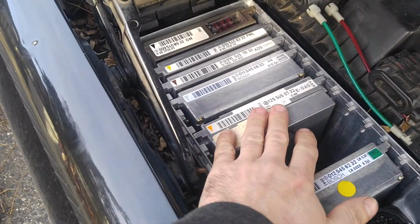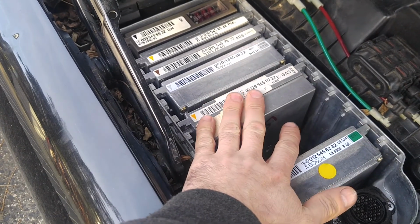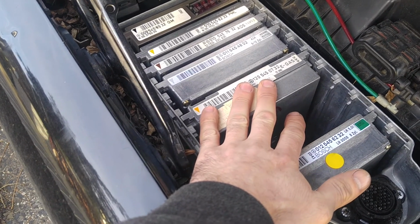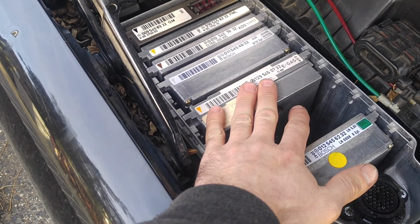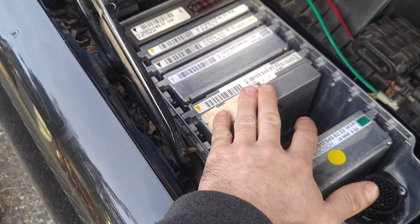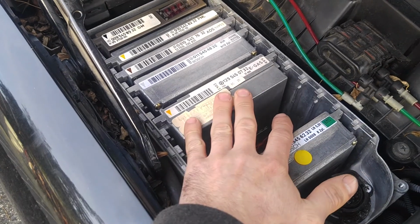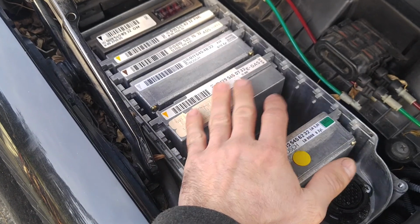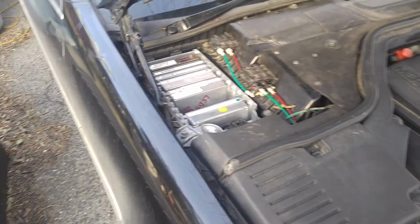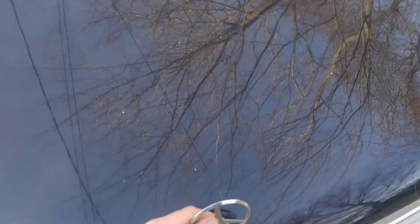So we're working here with an e-gas module that came from a 95 SL500, and I managed to repair this module. I'm going to show its operation, and actually we'll do a test drive so you can see that the unit works just fine. So again, this module came to me with a clutch circuit problem. It did not work. The ASR light was illuminated right off the start. The throttle body did not activate, and this module is installed in the 92 500 SEL. So I already tested it.